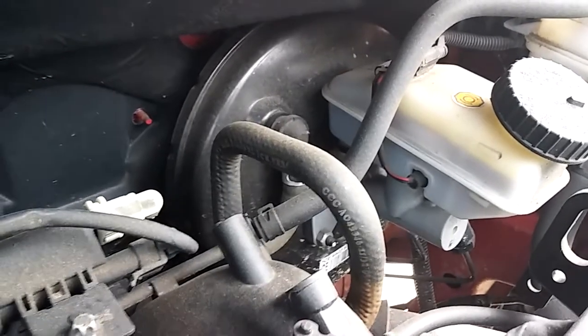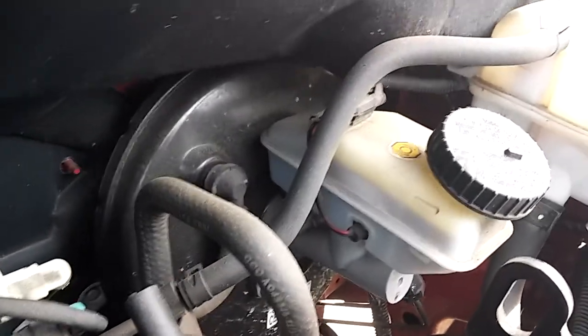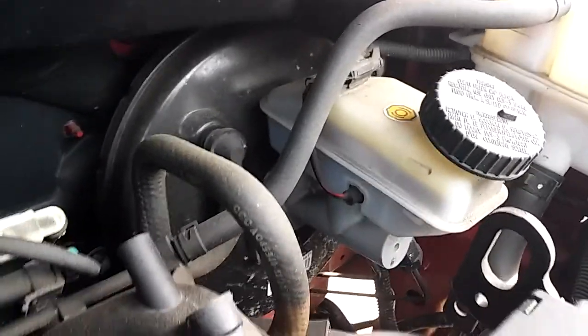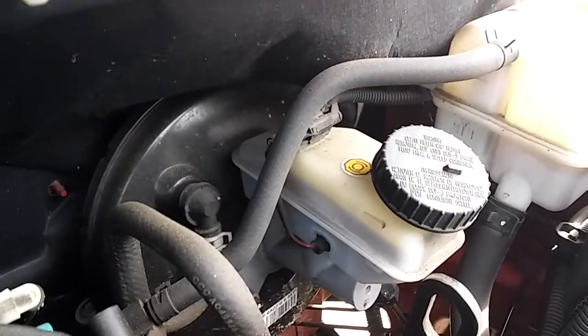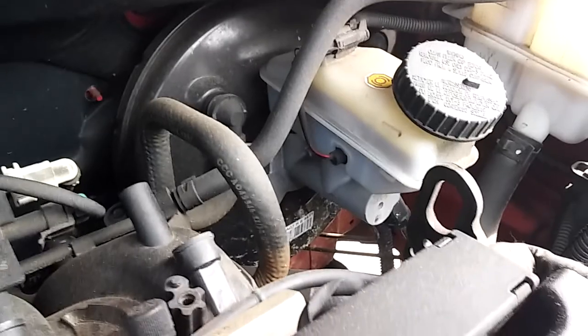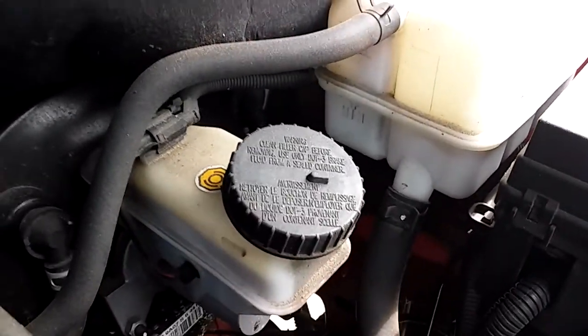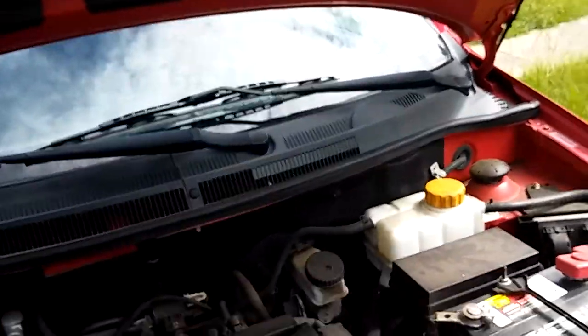The light hasn't come on. As the light comes on, I'll be checking the pads first, and then maybe after I do a brake job, make sure the fluid is topped off. Because I remember doing brake jobs and always topping it off, and then you push the brakes and fluid pushes up out of the cap. So I'm not gonna do that — I learned that from another YouTuber.